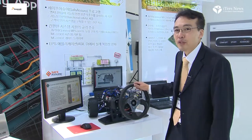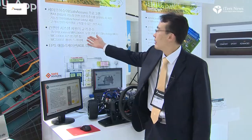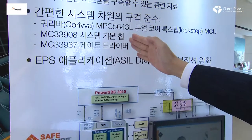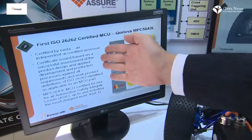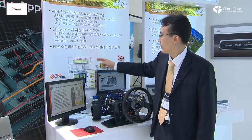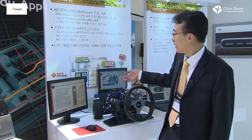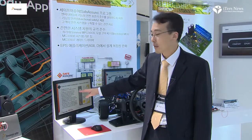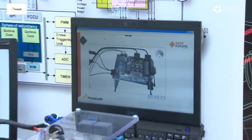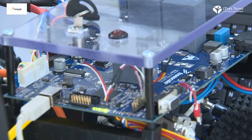This is our new EPS power steering reference solution using the Freescale Leopard Dual-Core MCU and our system-based chip at the gate driver, so customers can easily develop a power steering reference design with three Freescale components and a motor. This chipset is Freescale's first ISO 26262-certified product, certified by the independent company Exida, making it the first and only certified MCU in the world for ISO 26262 today.